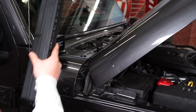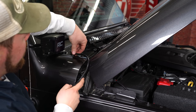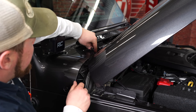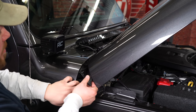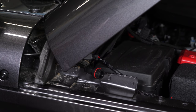I'm going to take the light bar and actually lay it over where the cowl would be. In order to get it in the right spot, I'm going to put it right along here, just tuck it in front, right along that edge, give myself a little bit of slack. There's actually a little foam pad here that pulls right out — pop the wire underneath, put the foam pad back in. The wire's now under the hood and we can get to the wiring aspect as soon as it's completely bolted up on top of the Jeep.